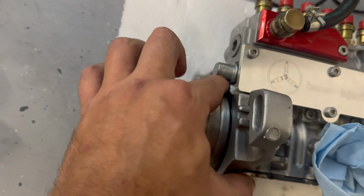All right, so we have our injection pump sat in. Stick your finger somewhat in the hole, and you can feel the gear line up. This little guy right here is gonna adjust the pump left and right. And we got it as straight as we possibly can without the bolt riding on the top of the pump here. So we're gonna get all 3 of those 13mm tightened up. And also, right where this bolt goes on the casing, there's actually a slotted groove inside this cast.